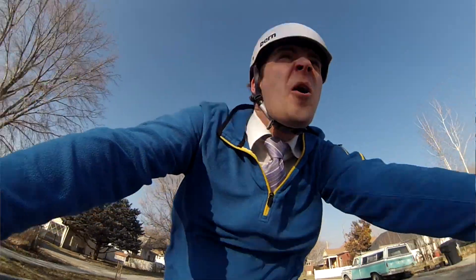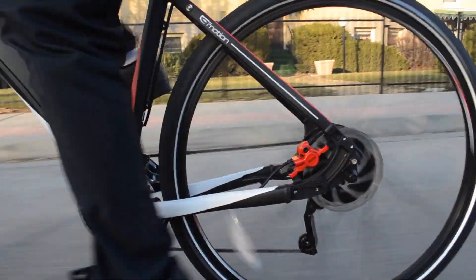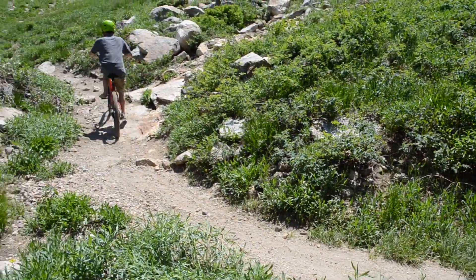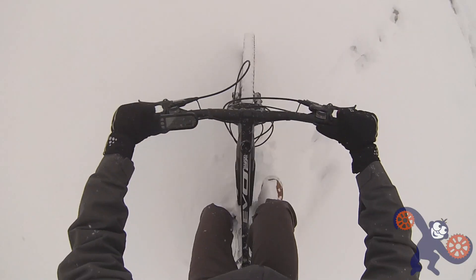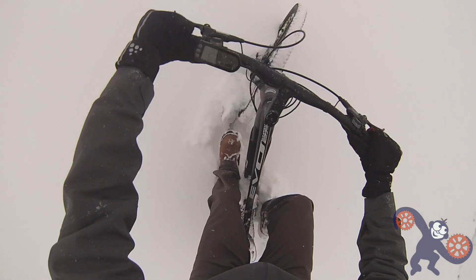So if you're cruising at like 30 miles an hour, this motor will chew through your battery really fast. Geared motors are really the way to go. Most electric bikes are governed to 20 or even 28 miles an hour, and most of them are used for climbing hills or powering up from very brief stops — or sometimes just having that really kick-in-the-pants fun of pepping around. This is prime time for the uses of a geared motor, because it has superior torque and efficiency for off-the-line and startup-heavy style of riding.